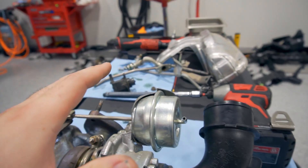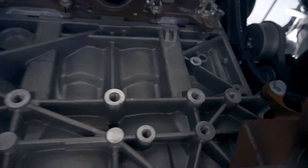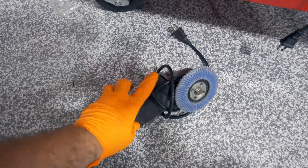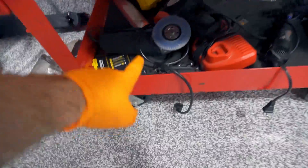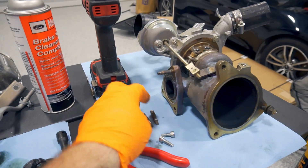The part people are a little afraid of with this turbo is modifying the block slightly. You're making a small clearance on this provision here — only knocking off the top side between 9 and 12 o'clock, about an eighth of an inch. I'm using an air tool with a sanding disc, kind of like a Scotch-Brite disc. If you don't have air, use a die grinder — you can get a flap disc at Harbor Freight for about $19 and the disc for about $3.99. Also, the studs are still in the manifold; the kit comes with new ones.